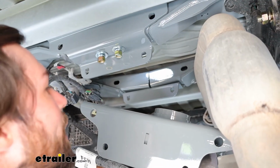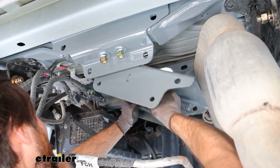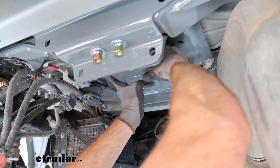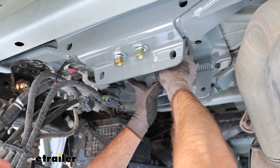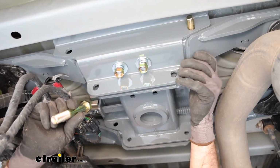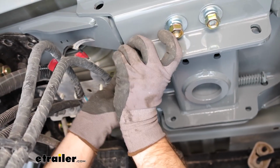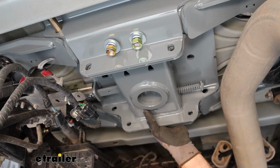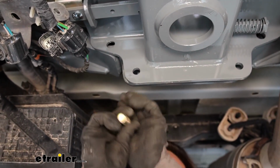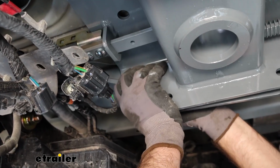Lift our center section into place. Just want to make sure that hole goes into the hole we drilled up top. So these back 2 bolts facing closest to the truck bed is going to face this way. And now going to the cab side, the one closest to the cab, the bolt head is still going to be facing the cab on the driver's side here.